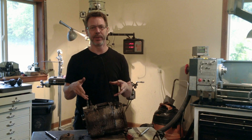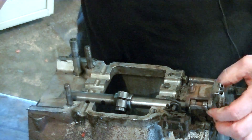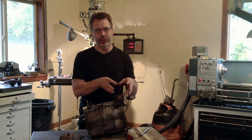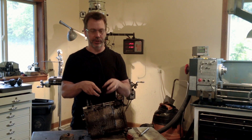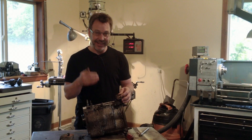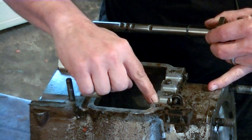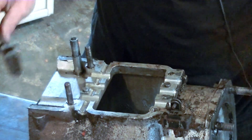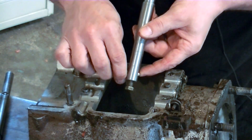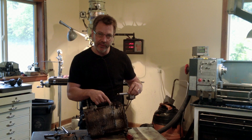The challenge with any of these Land Rover transmissions is they leak a lot of oil. When I show you the design, the shift rods fit here — there's actually three of them — and the shift lever comes down and activates them externally, where most transmissions it's all internally. So what happens is they put in these little square O-rings to help prevent oil from coming out. It doesn't work well. So we're going to put a new O-ring back in here, in these channels, and cut that out using a fly cutter. Now, the fly cutter that I'm working on has a great little tooth in here that's about the same size and diameter as the O-ring I'm going to be using, and it's also milled to match the radius of each one of these grooves.